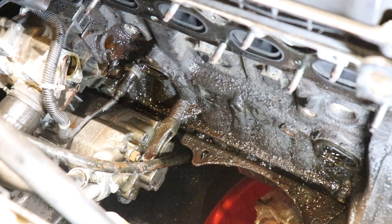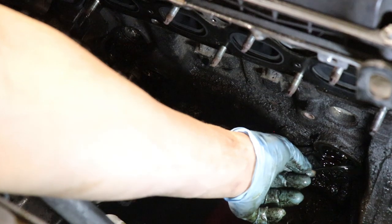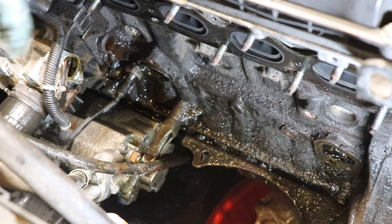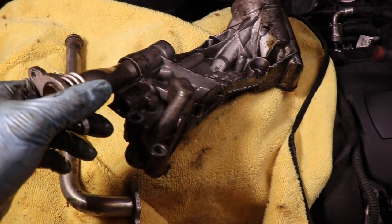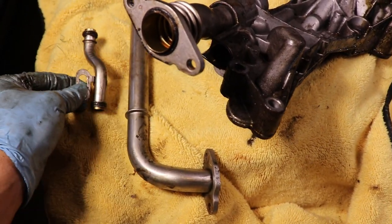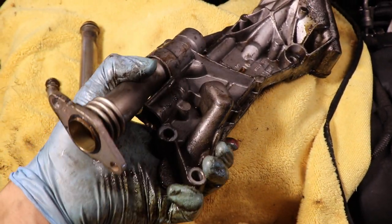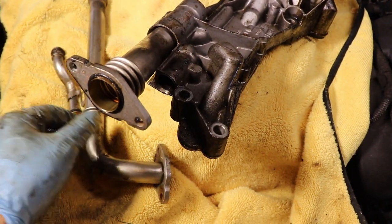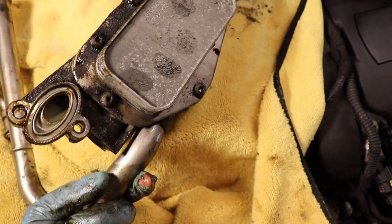So make sure there's no gaskets left behind. In this case, some of them stuck to the block, so we're gonna go ahead and remove them. There's one here, and then there's one here. Okay, so this is the old one. I'm gonna be replacing all these hoses, 1, 2, and 3. I'll put all the part numbers in the description below. It's better to just change them because I wouldn't want them to crack in the future if I just reuse the old one. So I'm just gonna change everything.